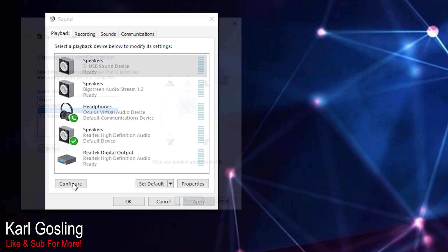The instructions then say to configure the sound card — so we press 'Configure'. You can see here it's on 5.1. You want it on 5.1 because there are four transducers in the standard kit: front left, front right, rear left, and rear right. If you're using the elite kit with more transducers, it still says to use 5.1 — that gives you a center and sub output as well. The instructions say leave it on 5.1, so 5.1 it is.